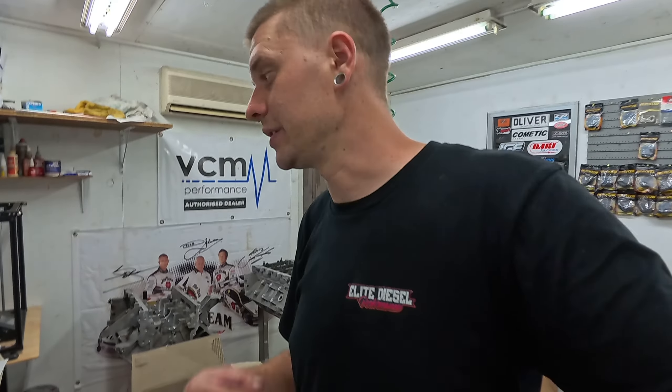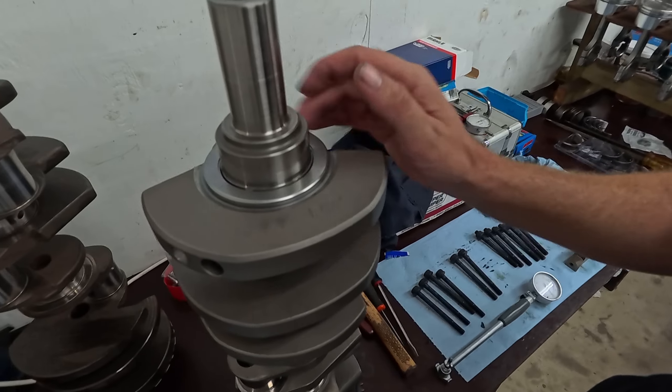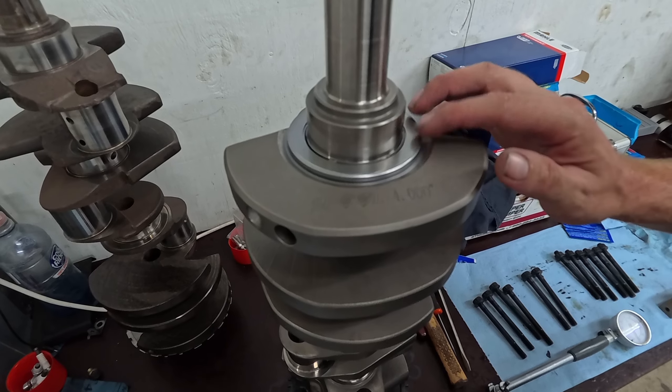Because of that, I ended up actually ruining a set of main bearings because I took too much off the front side of the thrust bearing — this wasn't seated properly and I didn't realize until after the fact. So that was a bit of a pain and I had to redo a lot of things. Lesson learnt. Ended up pulling it back apart and sending that back to the machine shop.